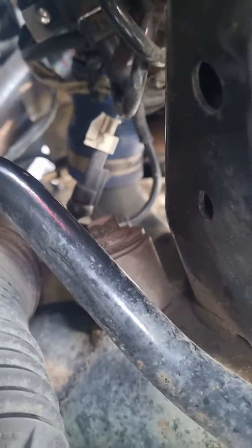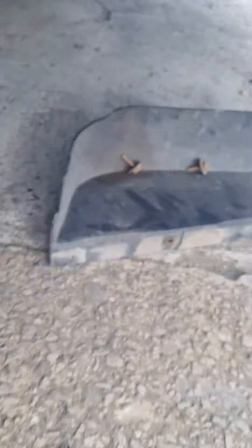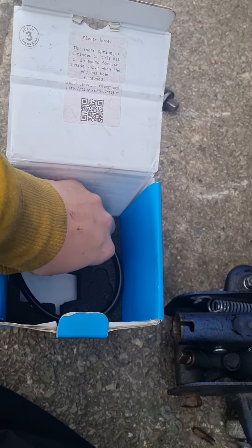It's all about leverage — it's a little tricky. It sits up in here. You've got three bolts on the standard, and you need to clip in the wiring plug. It does only go in one way and will clip when it's in. I just need to cable tie these up out of the way of the drive shaft. Simple case of bolt in, bolt out job — as you can see it sits up in there.